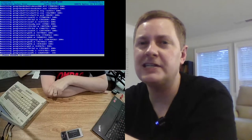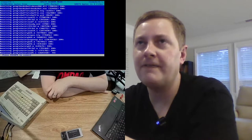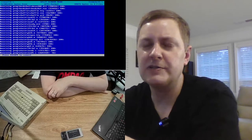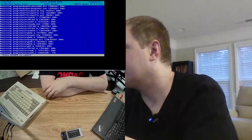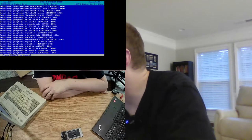I did put an NEC V20 in it, which I needed in order to make the XFS client work with MS-DOS, which is another file sharing and print sharing application that you will see here in a few weeks, running on the Tandy. So that's exciting. Web browsing on your Tandy 1000, says Geek with Social Skills.